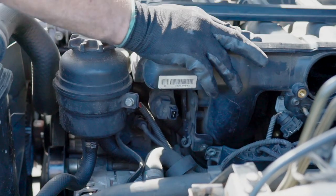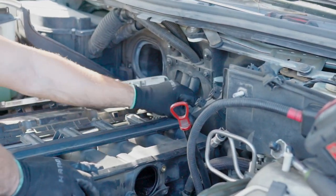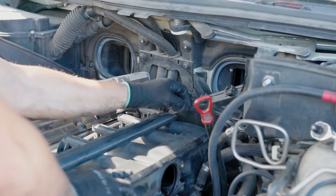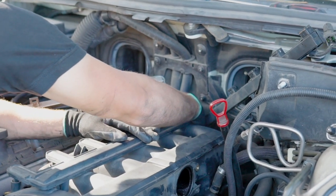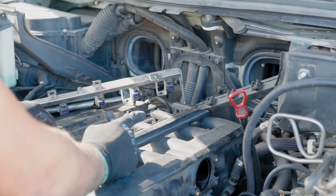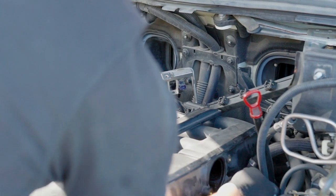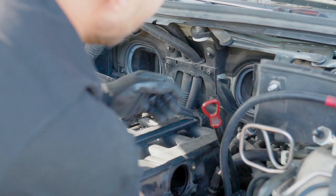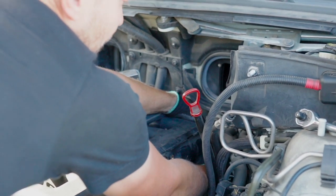The other things that are connected to the intake manifold are right at the bottom, in the end of the intake manifold. This fuel line might be in the bracket. We also have some vacuum lines going in there. I disconnected one of them already from the secondary air injection valve. And there must be an electrical connector for the secondary air injection switch, basically. So if you reach in there, you will definitely feel it. It's impossible to see, but it's there. This is the area where it's at.